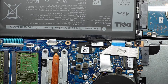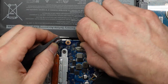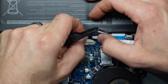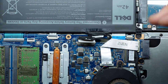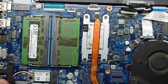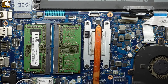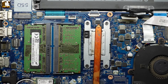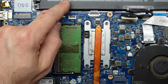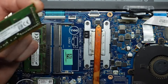I'm going to use a pair of tweezers just to lift up this tape so I can pull it back. That's disconnected. Now what I'm going to replace is the hard drive over here, but while we're here I'll show you how to replace the RAM. We have two sticks of 4 gig DDR4 — pull the two tabs, one forward, one towards me, and it sits up and pulls out.